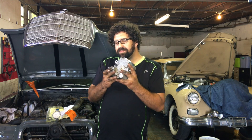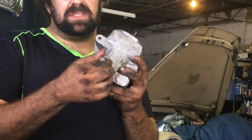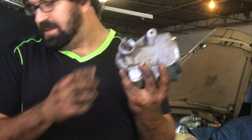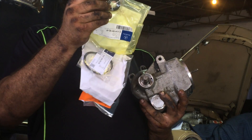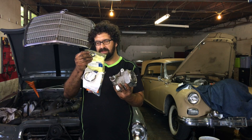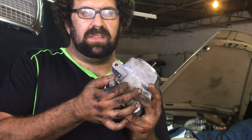At the front here, I did a little cutaway of this old pump so that you can see that there is a pulley that fits on here. And behind it you have a seal — this is what the radial ring seal looks like. For Mercedes, this is part number 0189976047, and it presses into the front seal here behind the pulley.